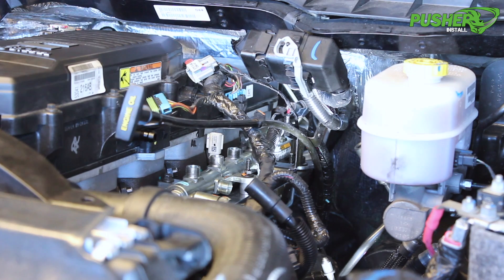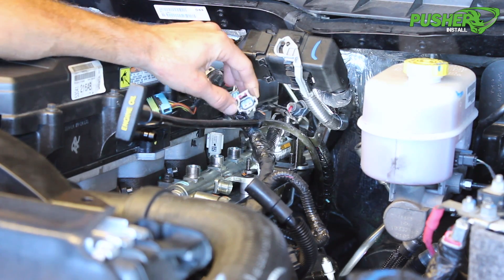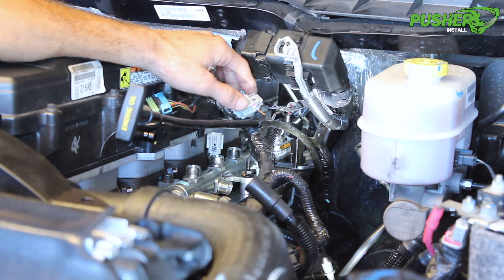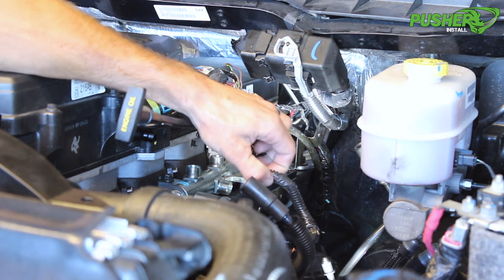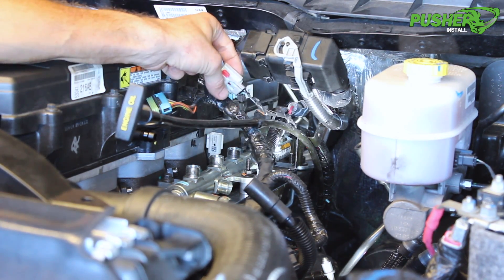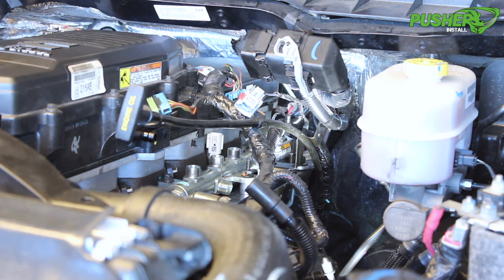We have our rail set in place. All the hardware is threaded in. We're just about ready to torque it down. Before you do that, you want to go around the edge of the heater grid delete plate and make sure your gasket's not poking out anywhere. Also look down in all six of your intake manifold bolt holes and make sure that the gasket is centered up on those bolt holes so when you put the manifold on you're not fighting that gasket trying to get the hardware through it. A little tip on these 2013 and newer trucks is the wire that branches off the main harness and goes to this plug for your air intake temperature sensor is a little short and the harness is pretty stiff. It doesn't really move around much, it doesn't have a lot of free play. So what we like to do is go in — the whole harness is covered in this kind of corrugated plastic shield that has a slit down the side for getting wire in and out of it. We just go peel off some of the electrical tape back there and pull some of this wire out. We pulled about three inches out here which gives us a lot of room to get up over the injector lines once they're there and plug that in. On the 2012 and older trucks this isn't an issue — the harness is a little longer — but on these 2013 and newer it really makes it a lot easier once your injector lines are in.